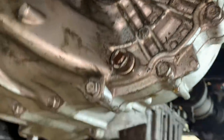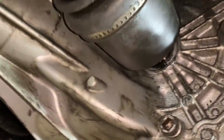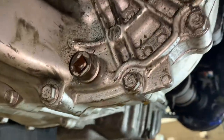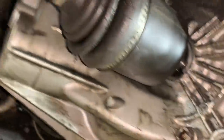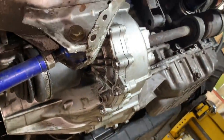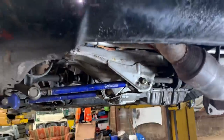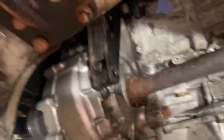I've just made another discovery - my gearbox is leaking a bit of oil. Looks to be coming from this side drive shaft seal. Since we're taking the gearbox oil out anyway, I may as well try and change that seal with a spare one that I've got. You shouldn't really reuse them, but I'm going to have a look. Maybe it's just been fitted wrong, or maybe because I've been changing the drive shaft so much I might have nicked it. So this has now turned into draining the gearbox oil and trying to see where this leak's coming from, and then we'll try and tap that thread.